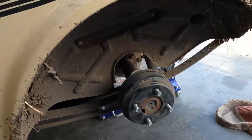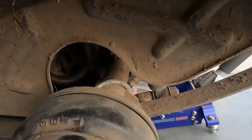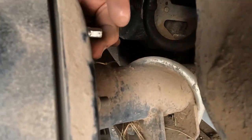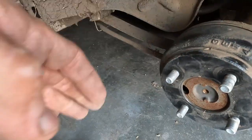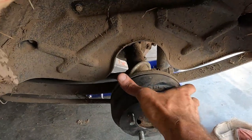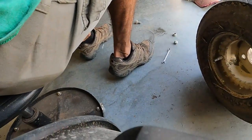It's got drum brakes. And I popped the drum off. The shoes are in good condition. And furthermore, they're adjustable right here on the back. There's this screw with kind of a square head on it. And you turn that in, and it spreads apart the top of the shoe. I can pull this one off and show you. Here, stay there for a second.